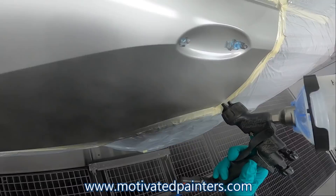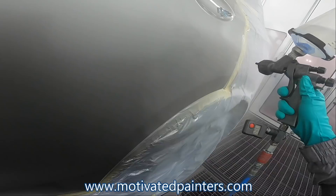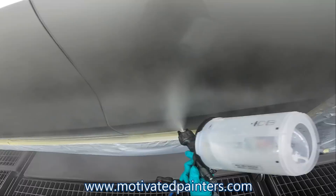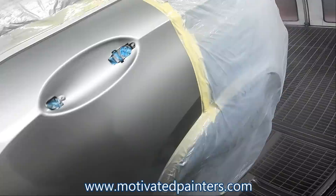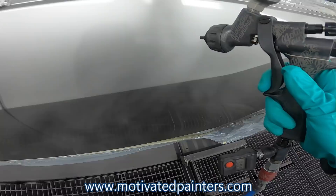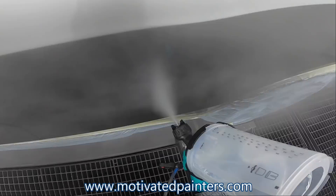Anyway, for my first coat I'm moving kind of quick. I have 30 PSI and I'm about 6 to 8 inches away from the panel. Just pay attention and go back to the video to watch the way I'm spraying because it's going to show you a lot. I'm using EC520, so it was only a one-minute flash — I only let this flash for one minute, and then I bake it right away at 120 degrees for 20 minutes.